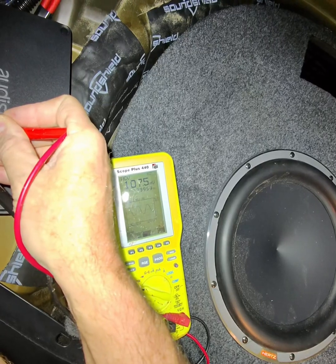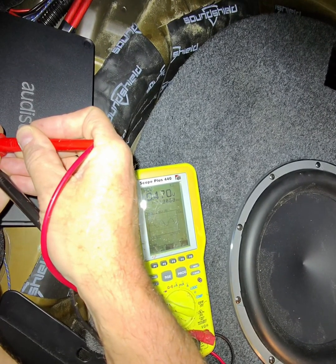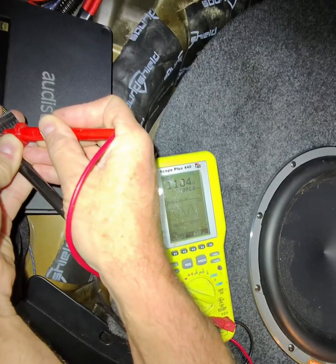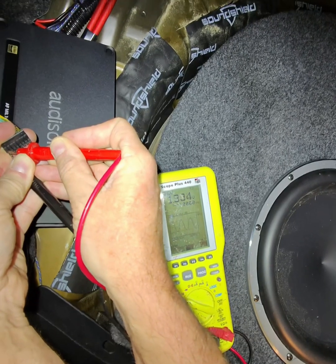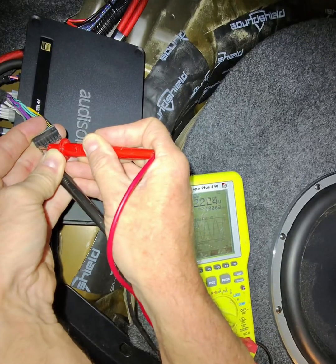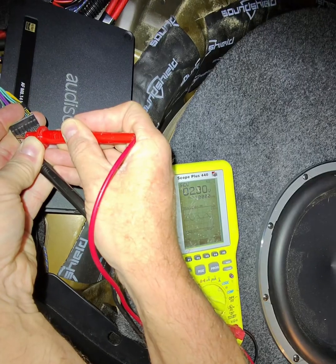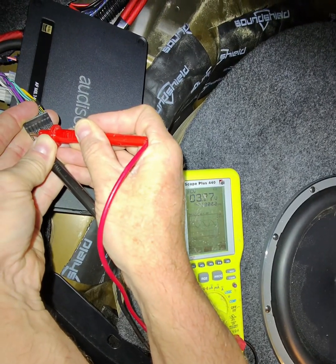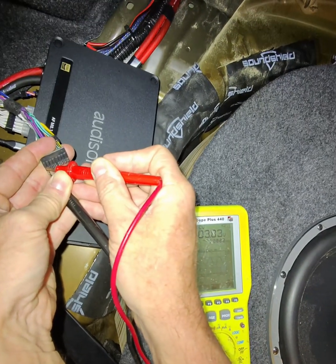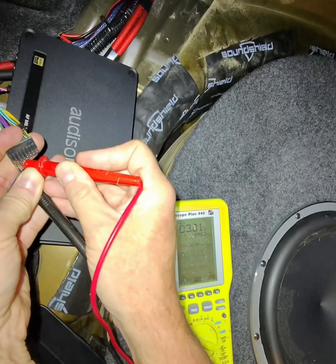All right, turn it up. All right, got 0.5 volt, 1 volt. All right, keep going. All right, just click one at a time now. Call them out. 35, 36, 37, 38, 39, 40. 40's all the way up? Yep. All right, so 40's all the way up, and it's clean. It's 3.8 volts. So if it's advertising 4 volt, it's not quite 4 volt.